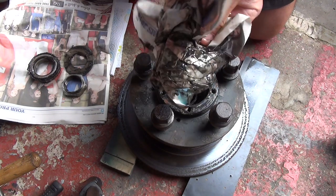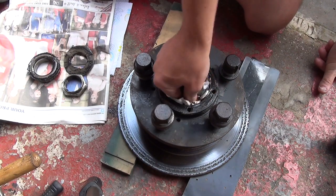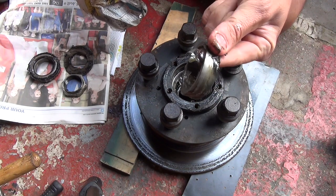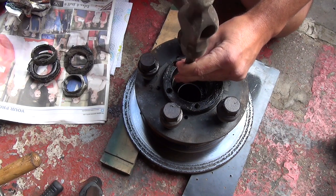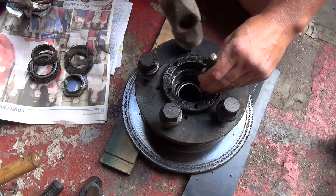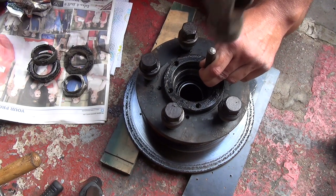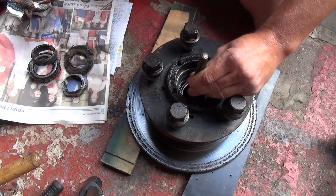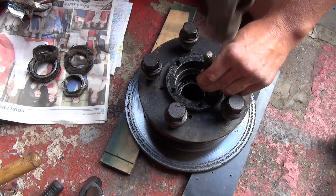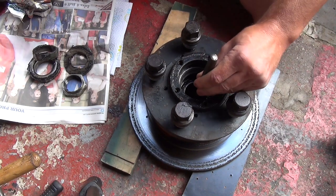You can put too much grease in, just as you can put too little. All these surfaces need to be clean when you put it back together. That is the center spacer washer which I will not be using again. Now tapping out the far side shell with a punch — do not damage the inside. There's a definitive lip on these shells. Work your way around and eventually they will pop out. I have the disc on wood for protection and I'm not going in at a sharp angle — you don't want to damage those surfaces.